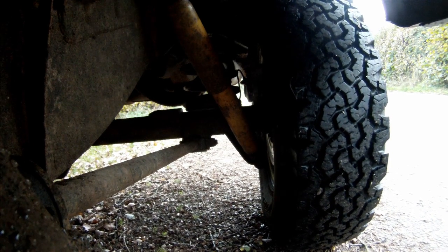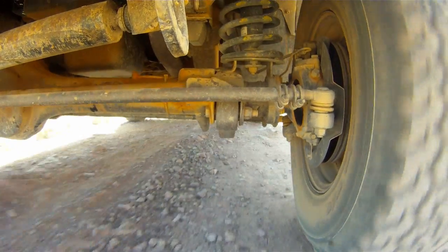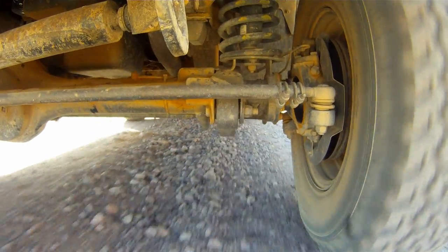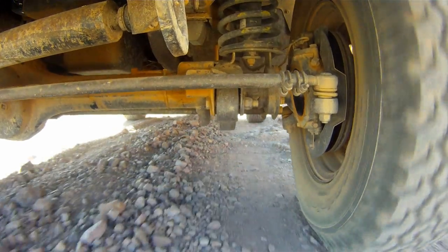Probably a few hundred metres up to half a mile would be the distance where the pedal would become soft again, and this is caused by adjustment of the wheel bearings being slack such that the hub moves relative to the caliper. It wobbles the pistons back into the caliper, and so on the first press of the brake pedal you have to push the pads back towards the brake disc.